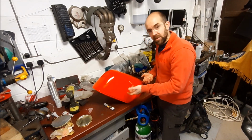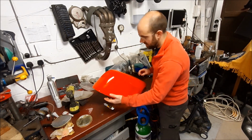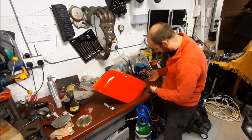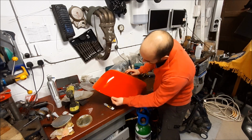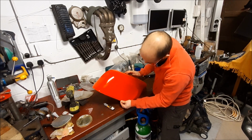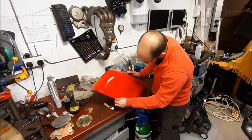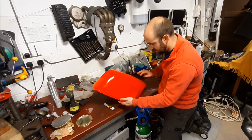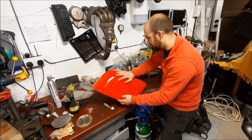Okay, plan now. I need to make this edging, so I've got a return edge for the mould. So what I'm going to do is cut a big piece of cardboard, which will run down here, up and across the front. Well, then the small lip around the edge, I'll be able to tape it down without leaving a line in whatever we mould on here. And that'll give us that return edge that we can shutter everything up to.